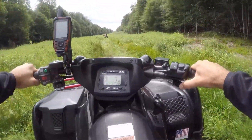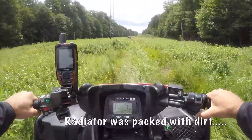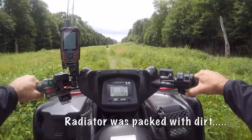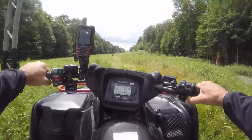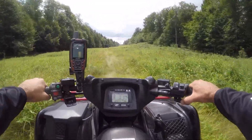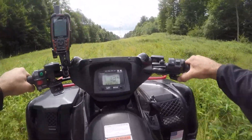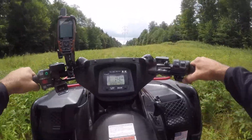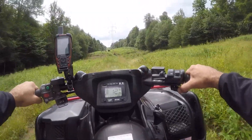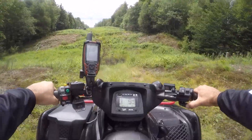The temperature indicator has been going off, which is a little concerning. But I have a feeling that's just because the radiator has some grit and that powdery clay that I can't get out — I'm going to have to use an acid to try to get rid of that. It's all right once I'm running and get some air moving. I get up to 30 miles an hour and I'm usually okay. The fan's running, so we're in good shape there.